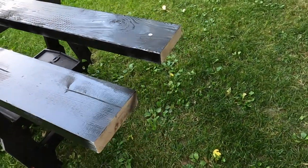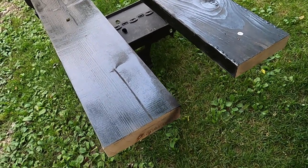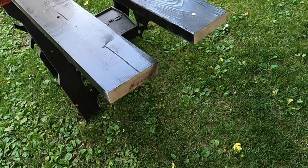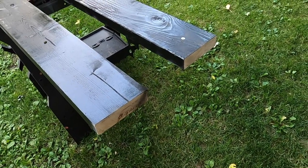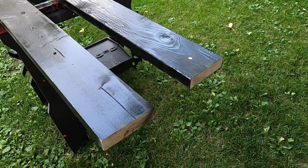So you just take these ends and you cut them down, bevel them, and that way it makes launching the boat easier because the boat's not rubbing on the carpet as much on a corner, on the edge, so the carpet will last longer. So yes, I've done this before on a different trailer, but let's get this job started.